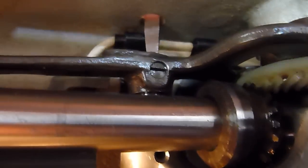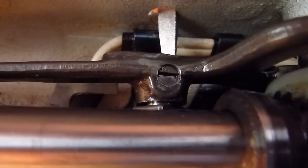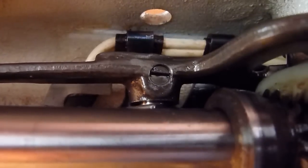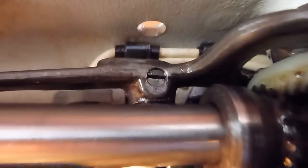To readjust the machine, reach through the back to access this set screw. This set screw controls the zigzag width, which you then lock down with that screw once you've made the adjustment.